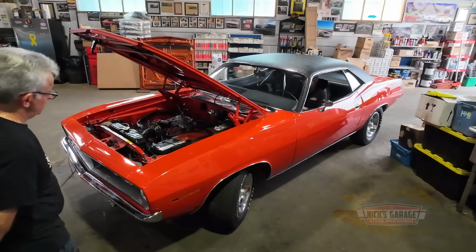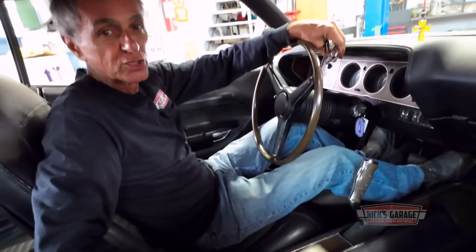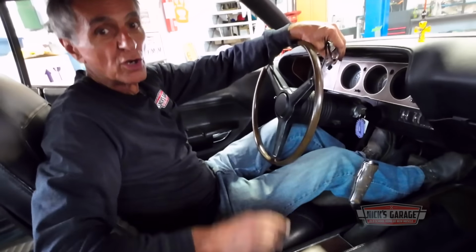Ari, my customer, told me, Nick, for what reason it doesn't start, we don't know. But you know what? He said the magic word, make a basic tune-up, because he has not replaced the plugs for a long time. Maybe make an oil change, and of course, see if the wires need replacement. So we had fuel, there was not a problem with the fuel. We've got a spark, the ignition is working, so we're just gonna do a little tune-up, and of course, I wanna make sure in a cold start in the morning that the choke closes well and opens up enough so it doesn't flood, or maybe it doesn't close.